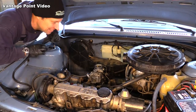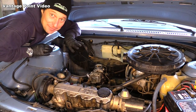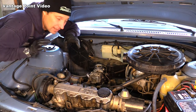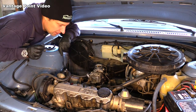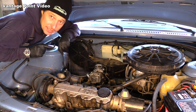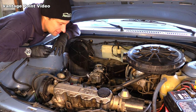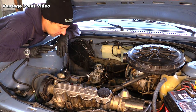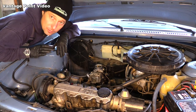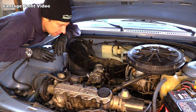So unlike when Vauxhall pulled the choke on that first day and nothing actually happened under the bonnet, now it's working well. And if you heard there when I pulled the cable, you could hear the engine's revs rise. That was without any throttle on from the inside. So that's working nicely now. So Mobi should start up and warm up more evenly now without having to apply throttle.